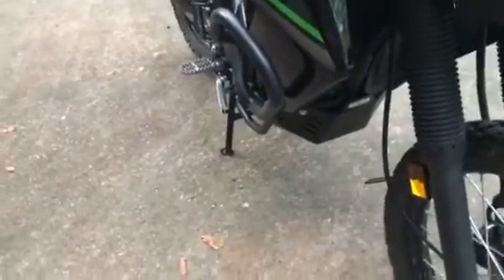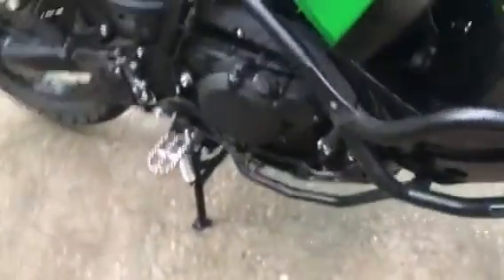The skid plate was actually slightly harder. It has four major bolts on it, and you can get three in place, but the fourth one is a little bit of a fight. So what I did there was just slide a nice little floor jack under it, and with a piece of wood I could easily move it right up and bolt them in. So that sort of worked out well.